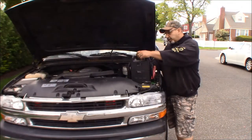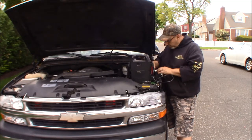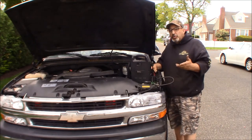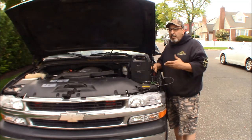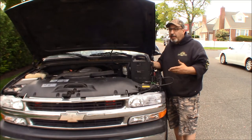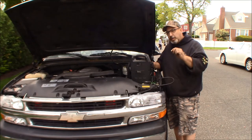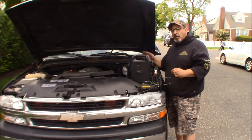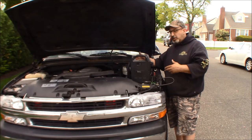So to be 100% honest, which I like to be when I'm doing these things, because things don't always work out as you had them planned. In the beginning of the video, I put that battery charger on. I put it on yesterday, and it should have been charged by now. But when I took it off and checked with a meter, I had like 8 and change volts in the battery. When I put the battery charger back on, it sparked real good when I put the negative on, and when I put the positive on, it sparked real good when I touched it to the terminal. And I watched the meter climb. It was 10.4, 10.45. It was climbing as I started to do the job.